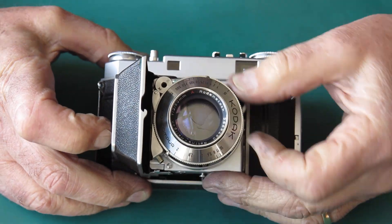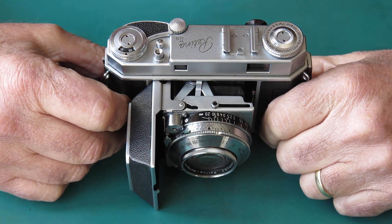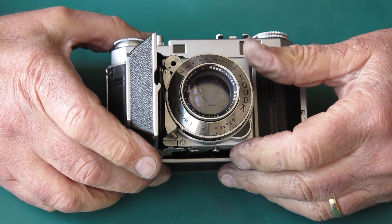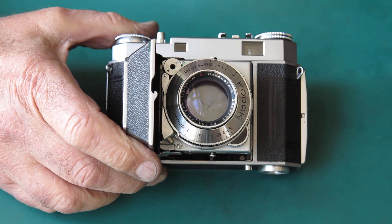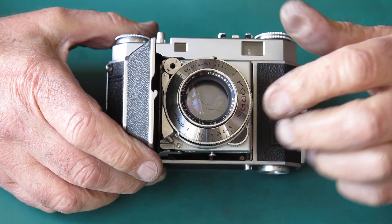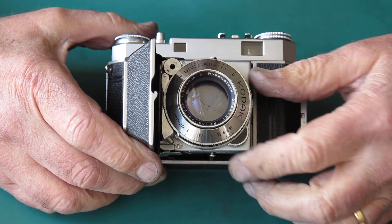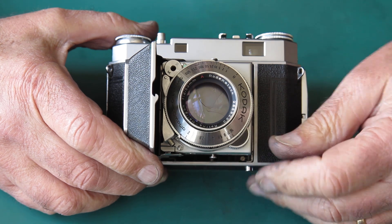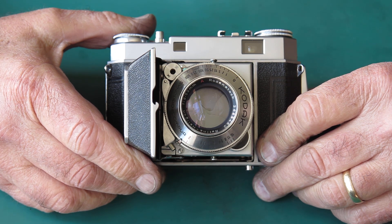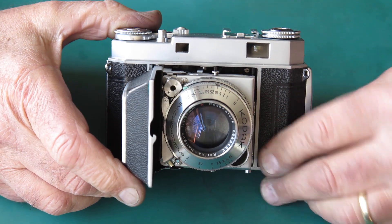It's all back together. The shim rings that were on the back of the lens and shutter assembly — there were too many. There were shim rings tucked under the front lens for no apparent reason; they should never have been there. To a certain extent, the shims added under the front and the shims behind the shutter compensated for each other. But once the front shims were removed, I had to adjust the rear shims — basically take out one metal shim and replace it with one paper shim. The damaged half shim and all the glue on the back of the shutter had to go too.